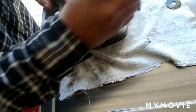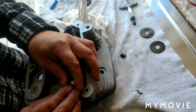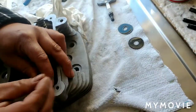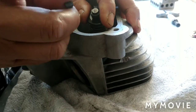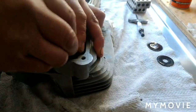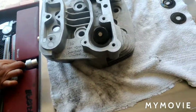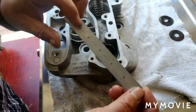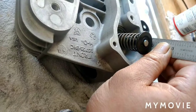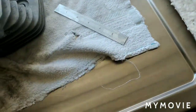Put the test spring on the intake side, and on the exhaust side. Now what we do is take a 6-inch scale and measure between collars. I'm measuring between collars and I have about 1.820 or 1.830 - something like that. To be sure, I can take a depth mic.